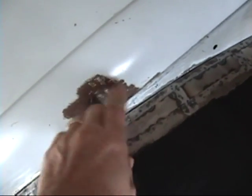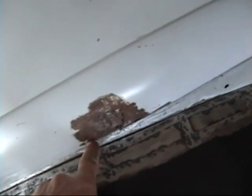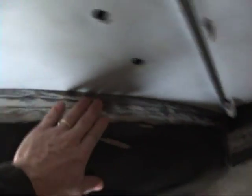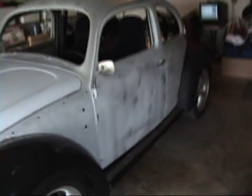There's a little touching up left to do here. This right here is a broken part on the hood — obviously this took a lick somewhere along the way. I'm going to have to cut this out and try to patch it and get all the curvatures to match all the way around. I just finished all the welding and pounding on this fender, and I went ahead and finished up the running boards. All the fender parts are all steeled in now.